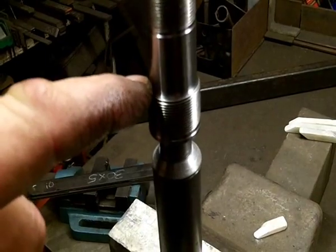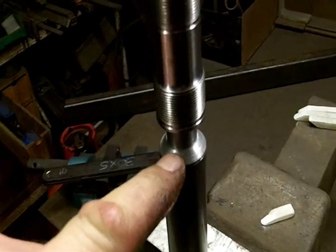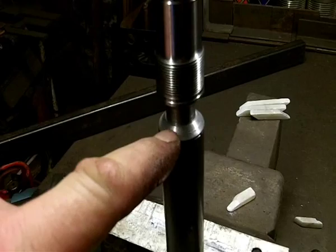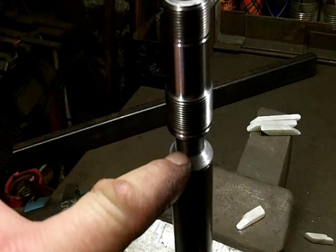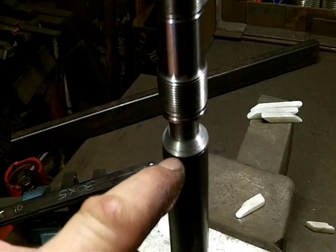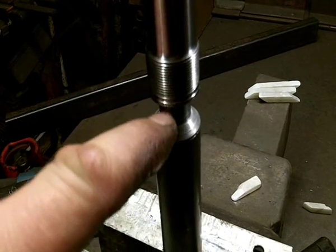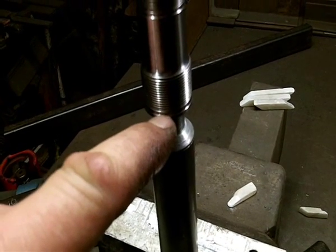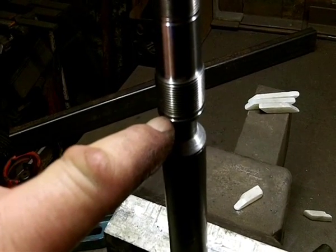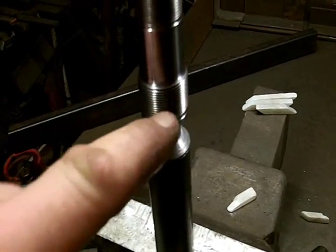I wanted this to be a really tight interference fit so that it would be obviously run through with the shaft. I centred the shaft on the lathe before I turned it, obviously, so that everything's nice and aligned. And then when I've got this in position and welded it, I will put it back into the lathe and I will turn the weld down to a smooth radius so that we've got a sort of slight taper. This is just under an inch, I think it's 24 or 25mm, so it's just a fraction under that, and that will allow the locking tab as well to fit.